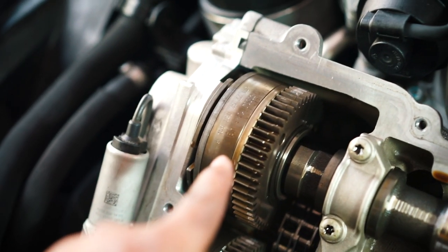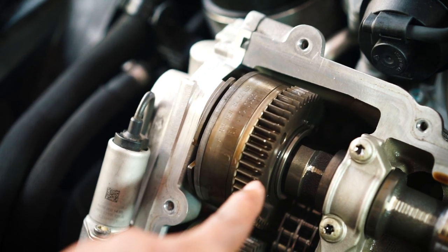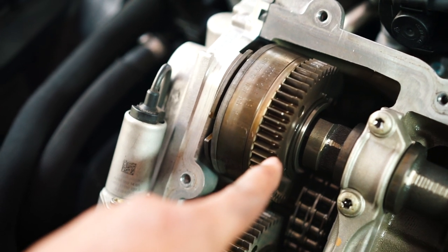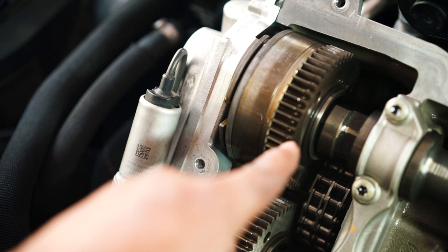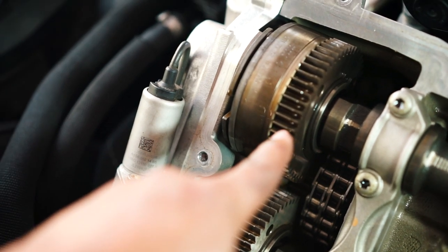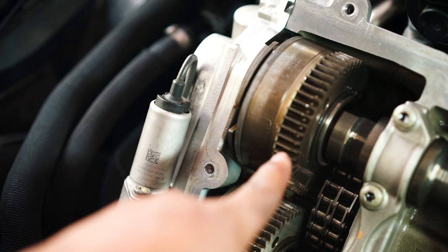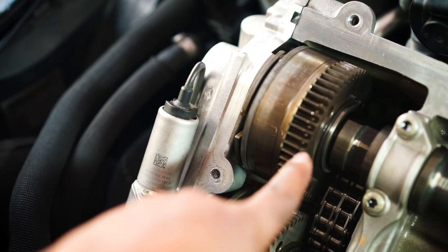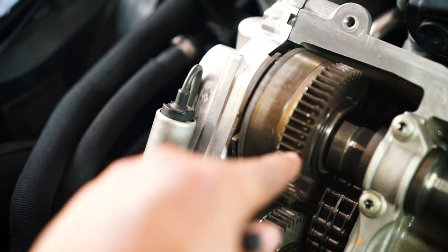All right, so on the adjuster, there's actually two parts to this gear here. One is stationary, the other one is compressed. So it's kind of a backlash gear compensation mechanism. Basically, I believe it's so you don't wear the main gear down too much. So this compensates for it and adjusts accordingly. And I'll show you more once we get into the actual adjuster and open it up.